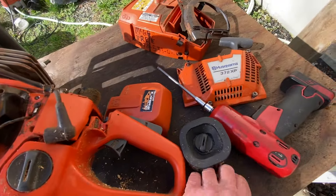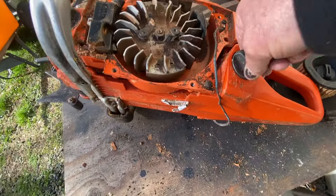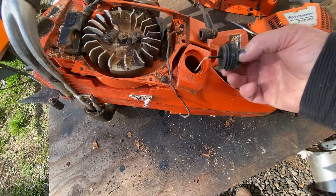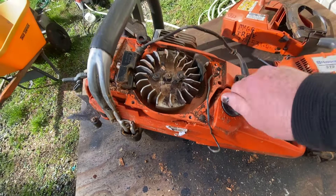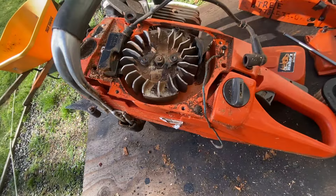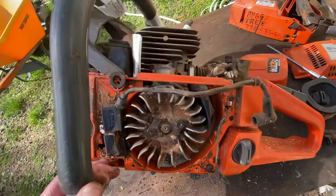It's just typically dirty as usual. This type of cap — every time you take these off, stuff gets into your tank, falls in there as you take it off. You'll want to clean inside the tank once in a while too, not just the fuel filter. Rinse it out — all those fine dust particles — because it'll start clogging your next fuel filter you put in.